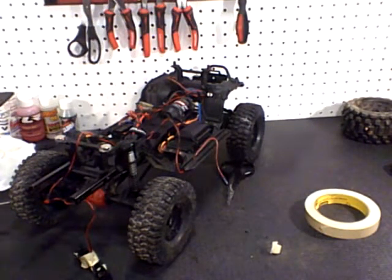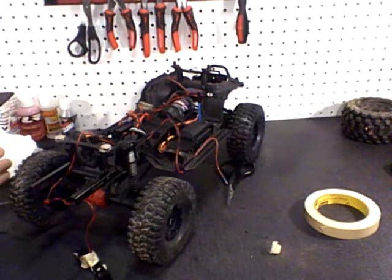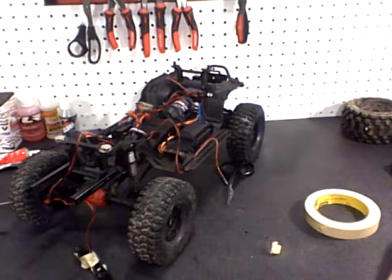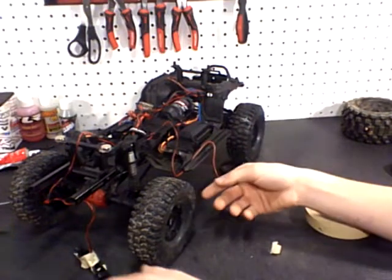So Kane Sample had Trenchers on his E-Revo 1/10, and the tires held up, but I stripped the wheel nuts, and they came loose. Well, if you keep on stripping them, Proline makes Raid rims now. Yeah, that's what's nice about those Raid rims. Instead of having to buy all new tires, just buy a little plastic piece. Or you could upgrade those wheel hexes to aluminum.